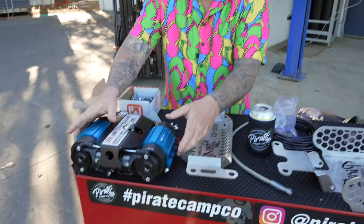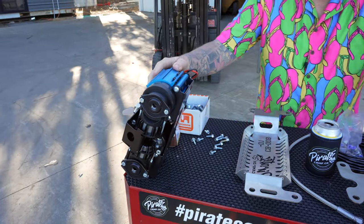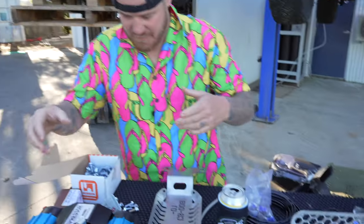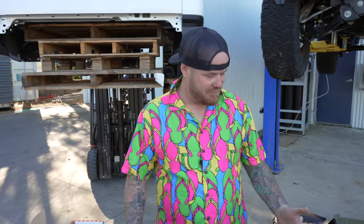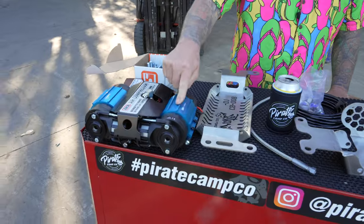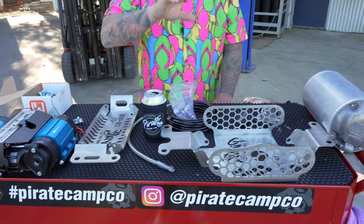What we're reusing out of the ARB compressor - we pull this bit off and this bit bolts into here. We'll install that one first. These bolts here are going to be used for bolting up through here into the bottom of the tub. We'll do a quick run-through as we go because we've got to disassemble this air compressor, roll these blue things around, and reassemble it all and mount it into the bracket before we can install it.